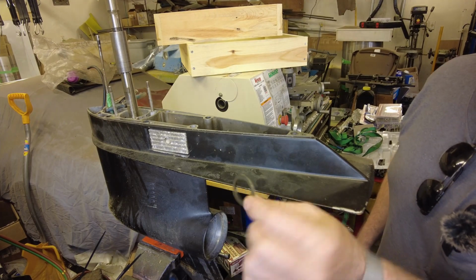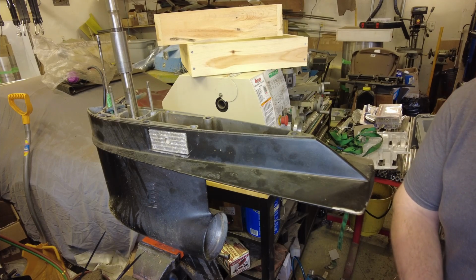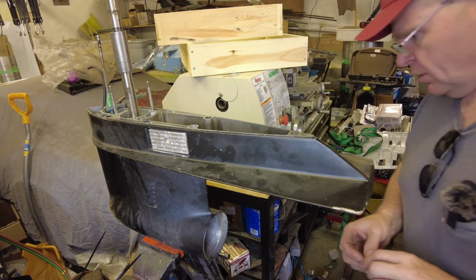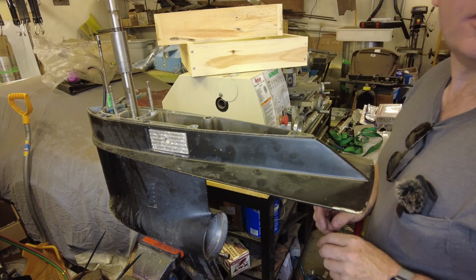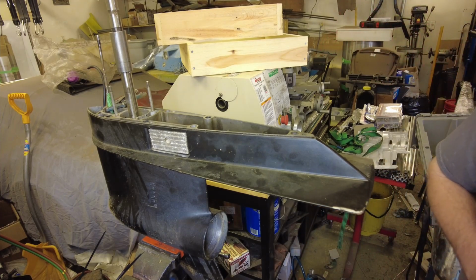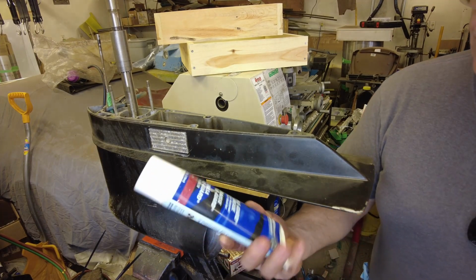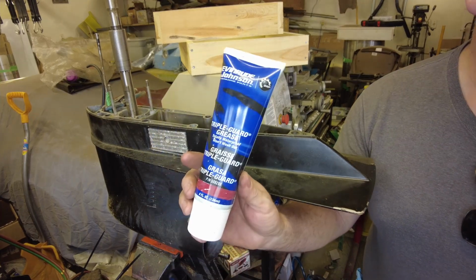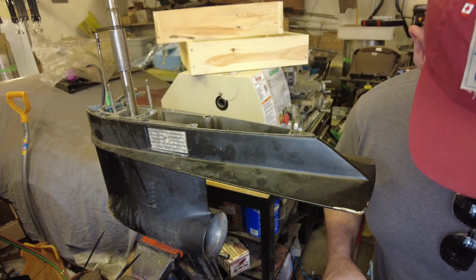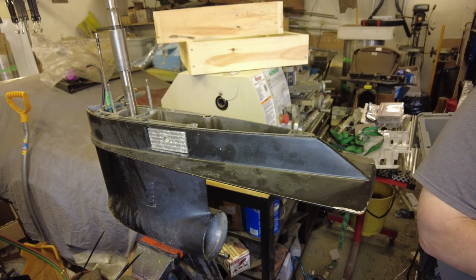This is the thrust washer. The manual says that it is supposed to be held in place by a little bit of grease all the way in the center of the shift dogs in the forward gear. And I wish I had shown that to the camera prior to putting the forward gear in, unfortunately. Now we need a little bit of grease to hold this in place. So for grease, what I'm going to use is the Johnson Evinrude BRP triple guard grease. I know this is for working on Johnson and Evinrude stuff, but it'll also work for a Mercury Force.